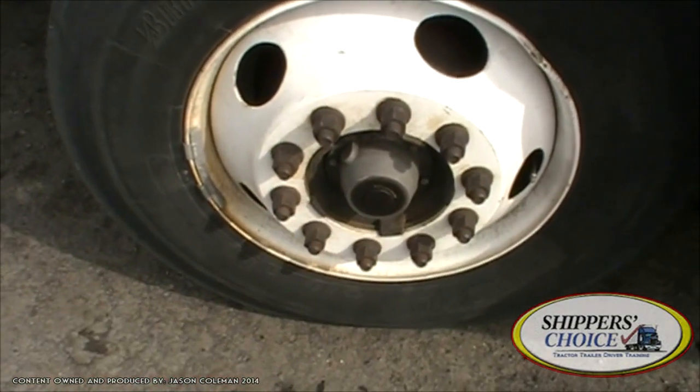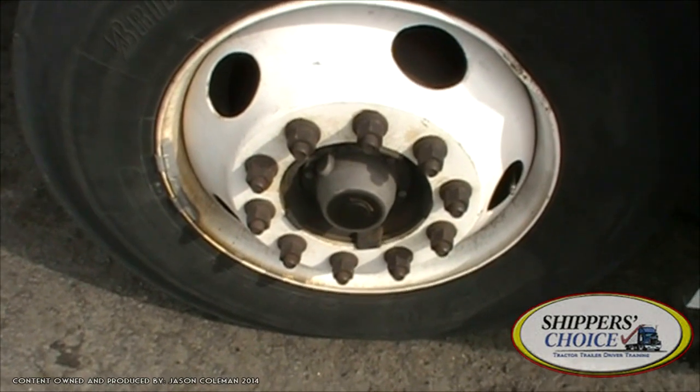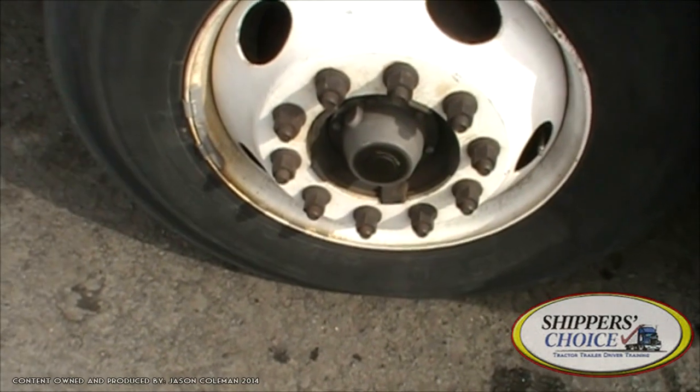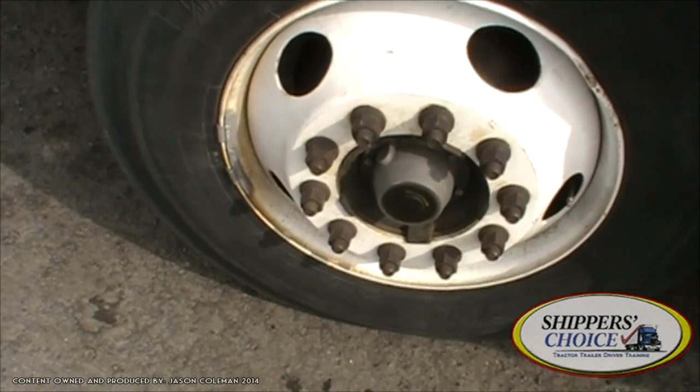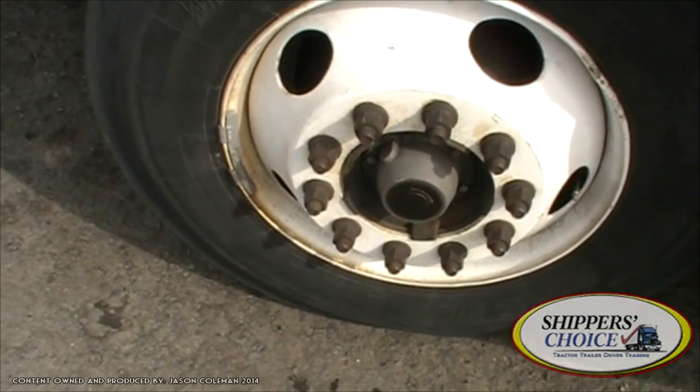My hub oil seal is not cracked, bent, or broken. All bolts are present. It's filled to the proper level and I see no leaks. It's important that you use descriptors with reservoirs and items holding fluid — things like 'filled to the proper level,' 'it's not leaking,' 'I'll check this daily.' Those descriptors are the most important thing to say.